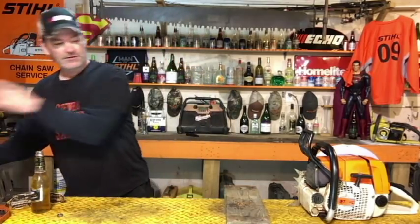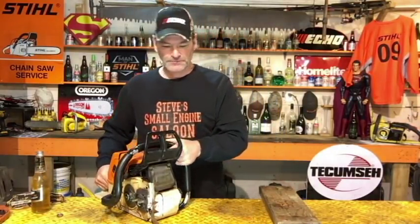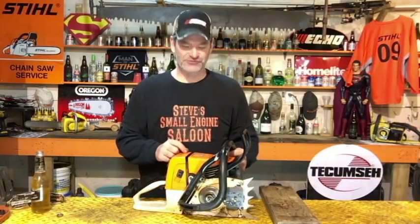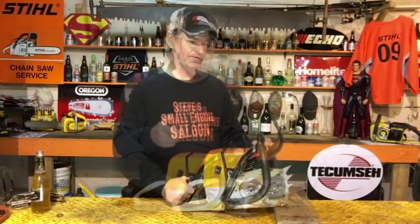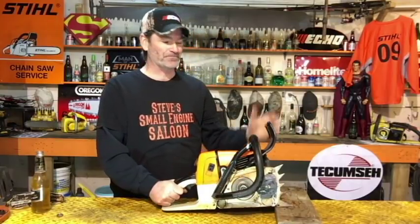Now, here is my buddy Wayne's 064, old Stihl 064. I picked this up from his house this morning so I could do this test on this video. I tested this. I did the drop down test. It didn't work. I started hitting it harder and harder. It still wasn't working. That inertia chain brake still had not come on. I was pounding this thing down hard, smashing it down. And then finally the inertia chain brake came on, but I was hitting it way too hard. Okay? Don't tell Wayne I did that though. It's a secret.